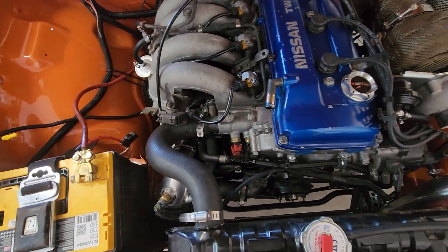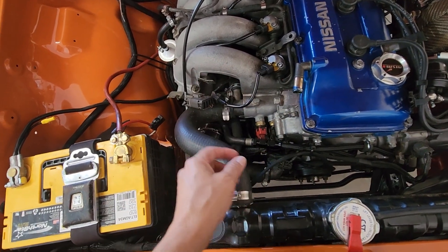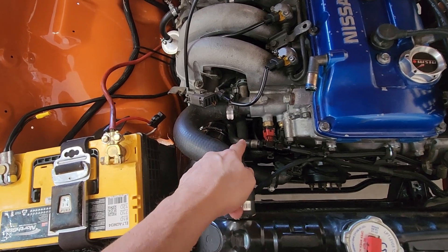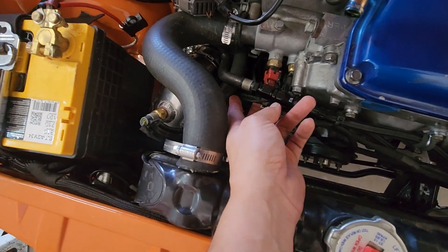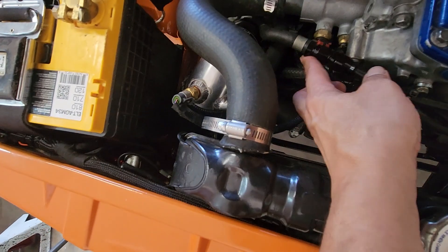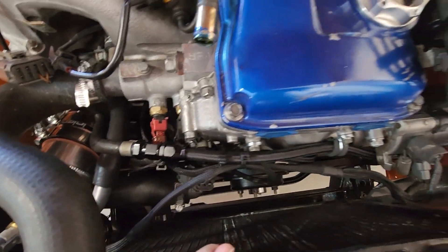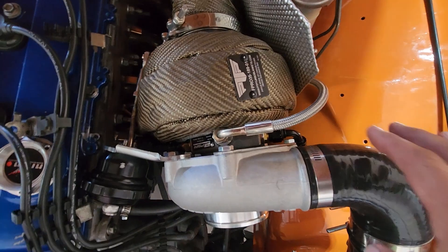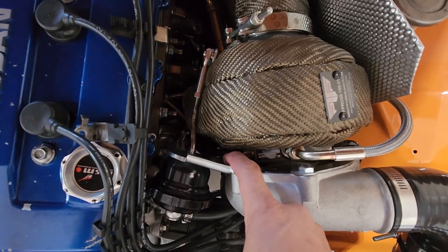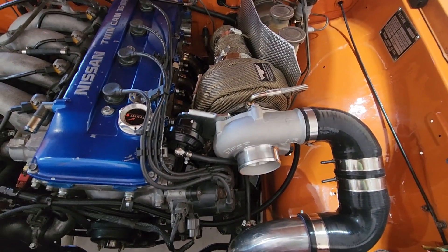Then we have the coolant plumbing. If you want to tap into your KA's coolant, the throttle body is heated through coolant. I live in a warm climate, so I just took the two coolant hoses off the throttle body and put 6AN barb fittings into them. There's a hose here and another one down here. I made some 6AN lines that route in front of the motor using P-clamps, and those go to either side of the turbo — one coolant line on top, one down below. I don't know that it matters which is the feed or return as long as it's flowing through, though I could be wrong on that.